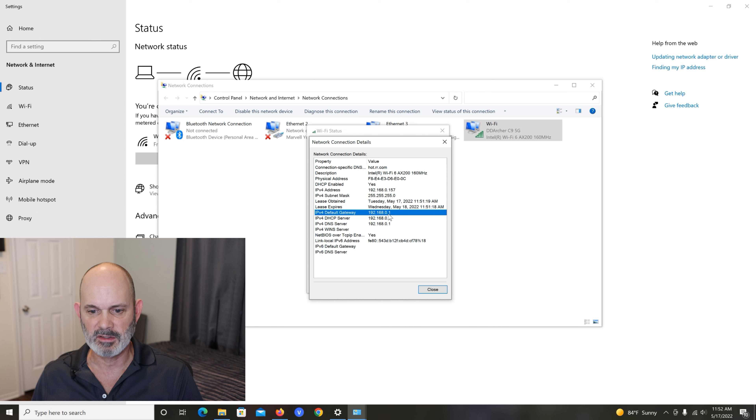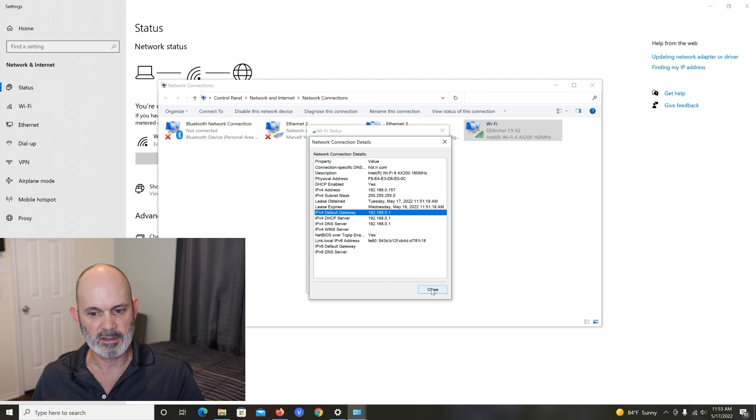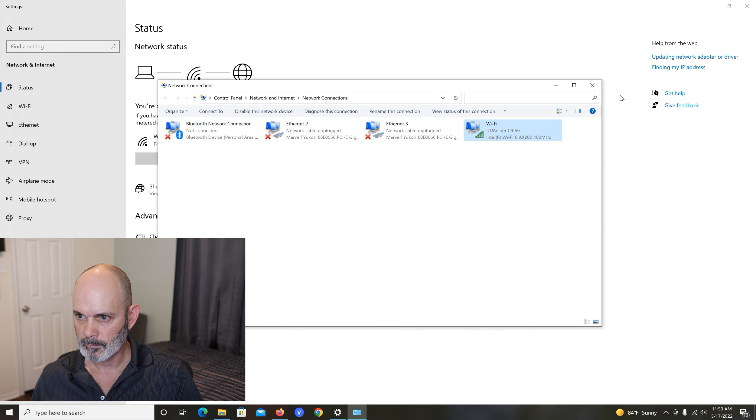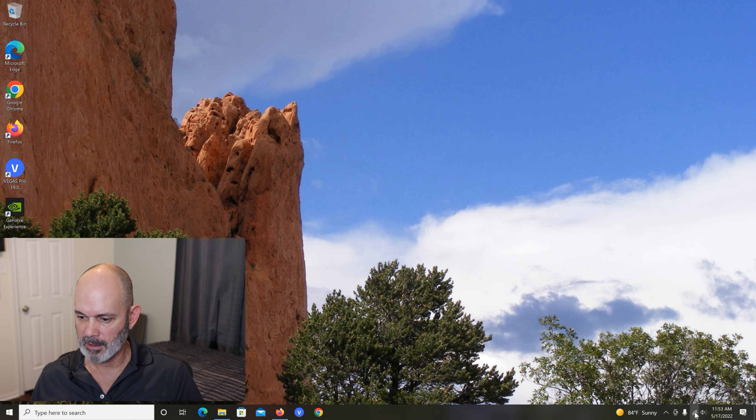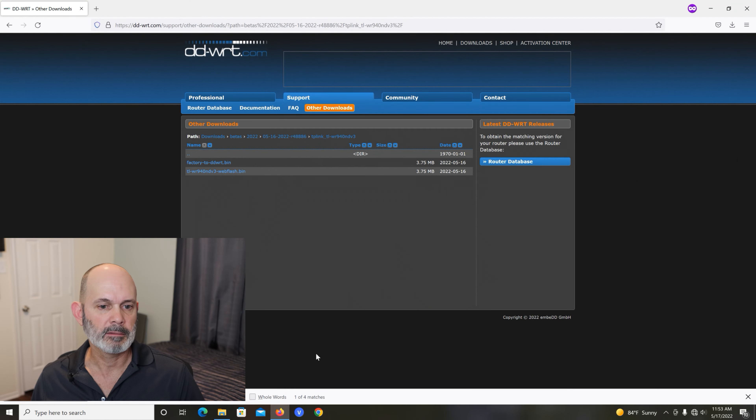The network portion of this number is 192.168.0 — the '1' is the node number. If it said 192.168.1.1 then the network would be 192.168.1. The only number you need to change is the last number. Make sure the first three numbers on the router match what you see on this screen, and don't plug them in at the same time. If you're unsure, just disconnect from your Wi-Fi or network and plug this router in by itself standalone.